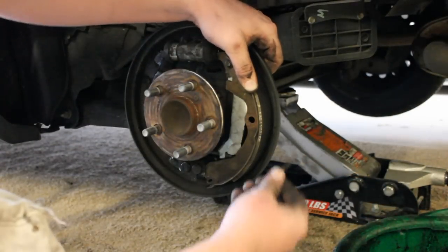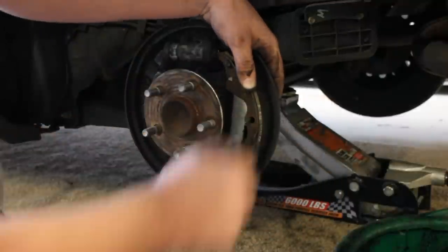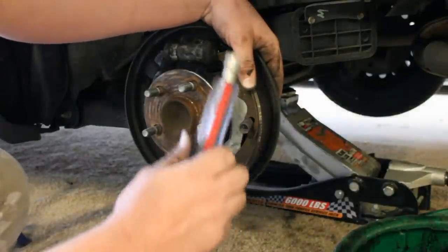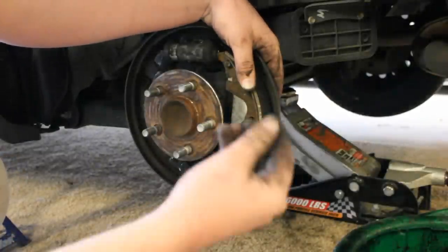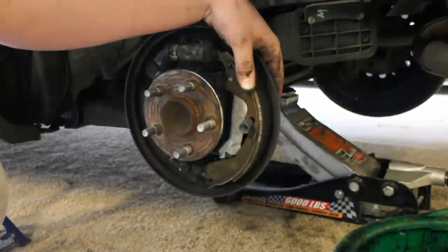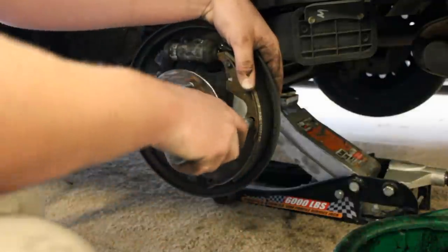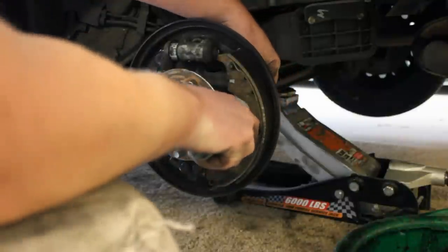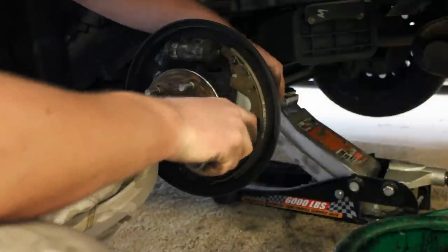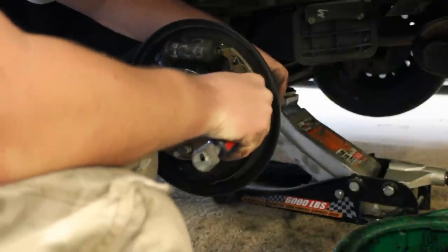The first thing I'm going to do is take one of my pins and stick them back through the backing plate where it came out. I've got them through the hole. In the beginning we used the dykes to take the thing off, but now I'm going to set the pin right there. I have a tool specially made for this. I'm going to set this little guy in the tool so I'm pushing him that way — it's going to be sticking out. I'm going to get him up over there, push, and then on the other side I'm just going to twist the pin and do all the work with the pin. Once I fit the pin into this piece, I will just twist the tool and let up so it catches on the pin.